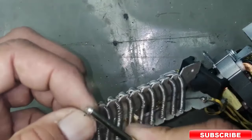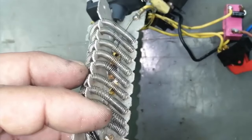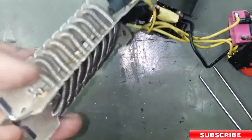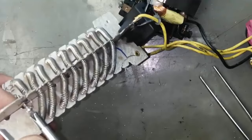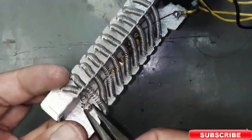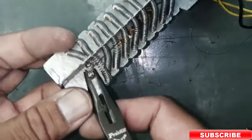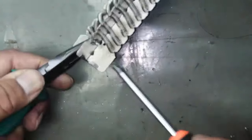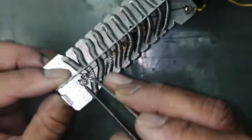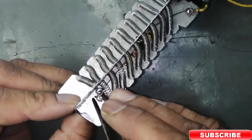It should not make a short circuit with the neighboring heating element spring. When you make any connection, make it secure. Now I am making the other twist to the other end of the wire. I made it a ring and now I am going to insert it in the nut and install the bolt here. Tighten it firmly — it should be secured like this. Now make good routing; the route must be separate from each other.